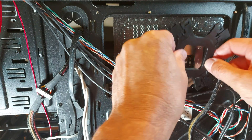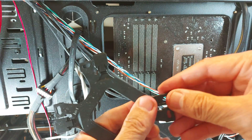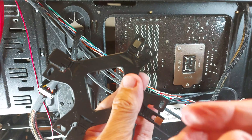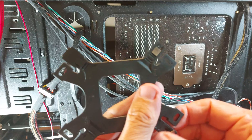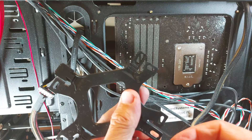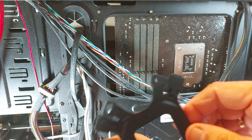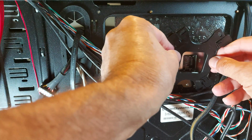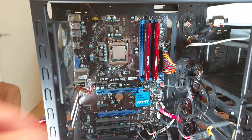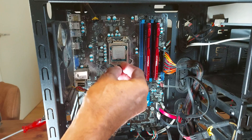This case has a big hole, but I still couldn't get the cooler into place because the lower edge of the bottom is in the way. So I had to remove the bottom screws from the back plate in order to fit it in. I still left the clips for locking the screws on the back plate. If you want to be absolutely sure that you won't damage the motherboard, it's better to get the motherboard out and install the back plate of the cooler outside the case. I am installing the bolts inside the case.